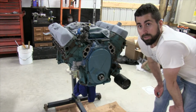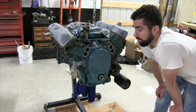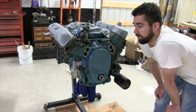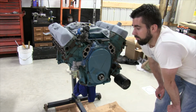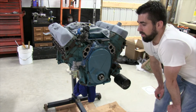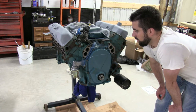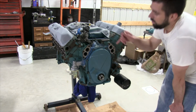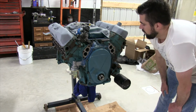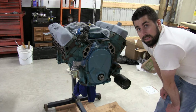Got the timing chain cover on. So we have the 3-bolt cam and timing chain. So we got grade 8 bolts, 3/8, Loctited them down, torque to spec, which I think was like 40 pounds. Put the cover on, after cleaning up all the bolts. Again, aviation sealant gasket, aviation sealant cover. Yeah, so that's where we're at.